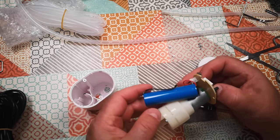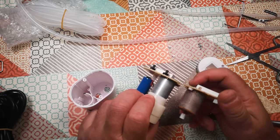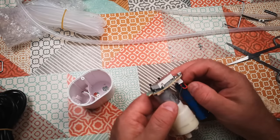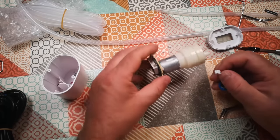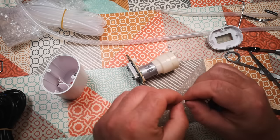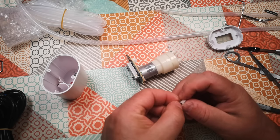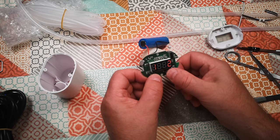The battery comes out of this one, and there's a lot more glue on the battery. The motor looks in much better condition by comparison — pretty sure the previous one had been wet for a while. I'm going to take the glue off that connector and disconnect the battery. My sincere hope is that resetting it like this might reset whatever component — if there's some kind of overcurrent protection built into the circuit, unplugging it for a moment might reset that. Not tremendously hopeful. No — it doesn't run the pump.